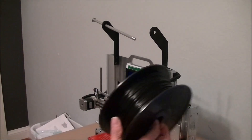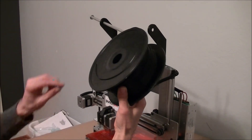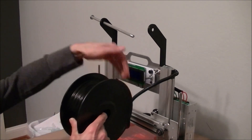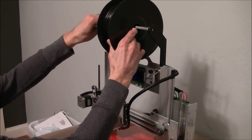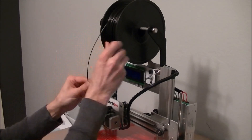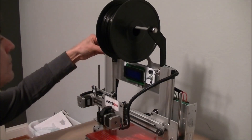Next, we will install the filament on the spool holder. I like to leave one coil of filament out so that I can quickly load again after changing spools. This will also not allow the coil to knot from cross-threading the spool coils. Place the nut back on the rod with a couple turns. Make sure you have installed the filament with the end coming out from the top. Then replace the end caps on each vertical slide.